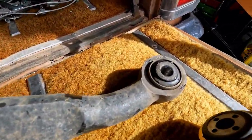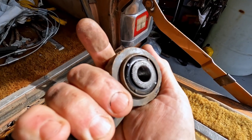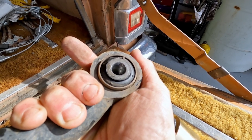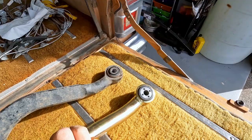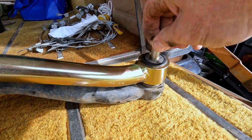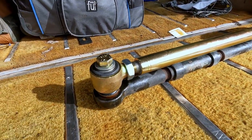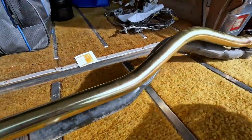The axle is almost perfectly centered, so I'm going to measure from this point to this point and set the new one at that same distance. What I noticed and what concerned me from the very beginning: when you use the stock hardware, look at the way the threads have ground themselves into that sleeve — and that causes clearance. That goes back to the secret I'm going to share with you about reinstalling this with the stock hardware — not going to do that. Another way you can check this is to just link these two ends with a bolt running all the way through — if it slides in, you've got your length exactly right.